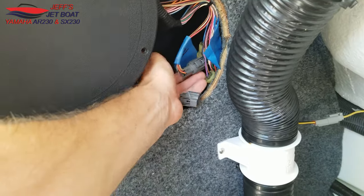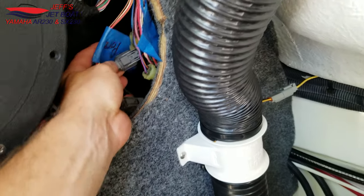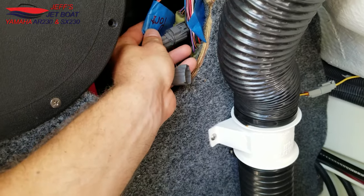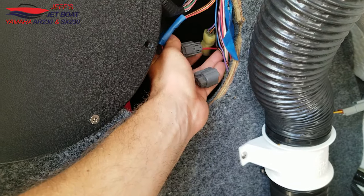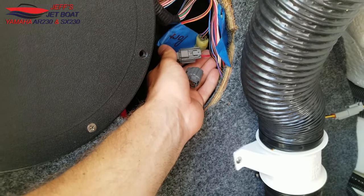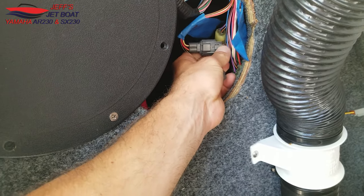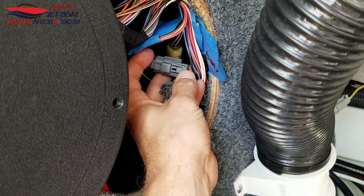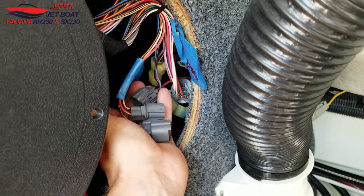I already have tape on mine. You should have little caps attached to the connectors — I'd recommend labeling them port and starboard to make things easier. Today we're dealing with the port connector. We're just disconnecting it from the main harness. That red wire leads up to your gauge and informs you of a malfunction. To disconnect it, you just push down and pull it apart. The connector with the three wires is the one you need — hook up your YDS cable connector to that.